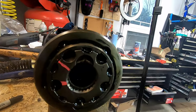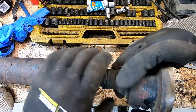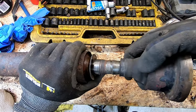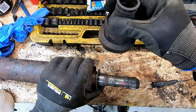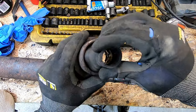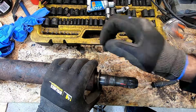We're not really touching this side; we're just going to replace the bearing and put it right back together. Now we've got to take the shield and the rubber out, ideally without tearing it off. Nice and easy — we don't want to lose the marks. There's a bit of a tear here but we don't have it as a spare part, so it is what it is. This has to go in front of the bearing.